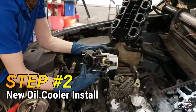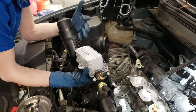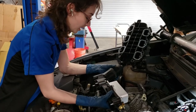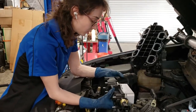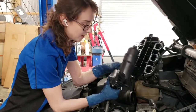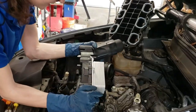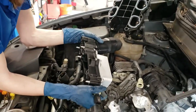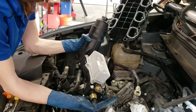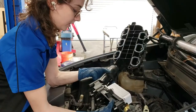So this is the brand new part. It's not OEM — I didn't know until after the fact that it's really better to go with the Jeep part. This is okay, but the one that I just pulled out was an aftermarket one and I think it was just one of these O-rings, not the part itself. You can tell if it's an aftermarket part because of these oil plugs — the original OEM part does not have these. But it's still a fine part. These things fail anyway, so I don't know if it's worth it to save a buck or to go with the Jeep part and have to replace it just later on down the road. But this job has been done before, so that's up to the individual.